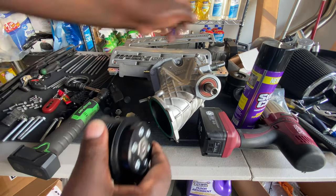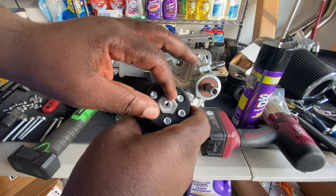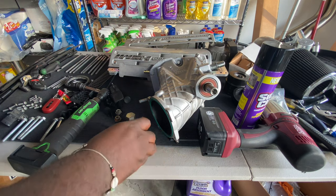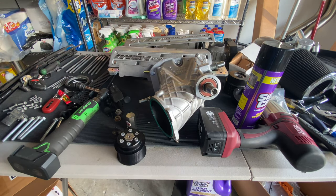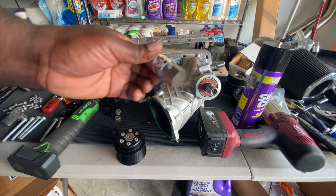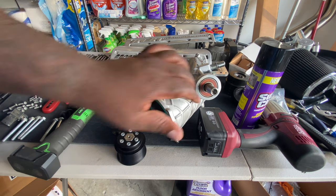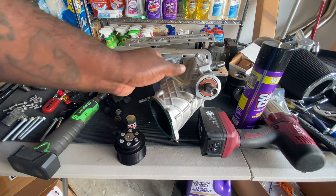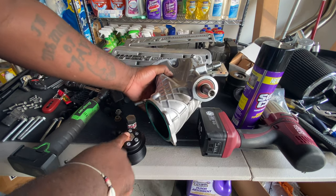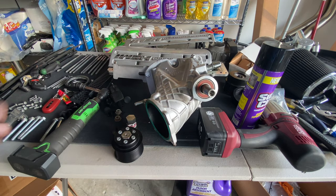I could just get another TBA Machine pulley in a different size. All I have to do is just take these Allen bolt screws out, slide it off, and then slide it in. Because once I take these all off, the part that goes onto the snout is going to stay on there. It costs about $39 bucks, and in all I think I paid like $50 or $60 bucks with shipping from High Horsepower out of Delaware. I'm going to torque that to about 60 to 65 foot-pounds of torque.